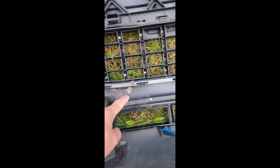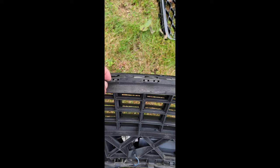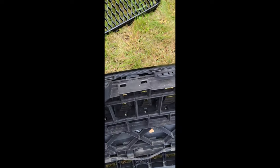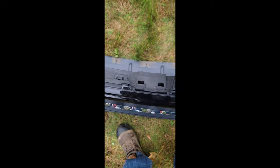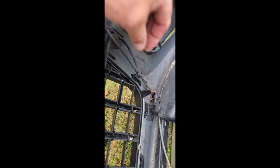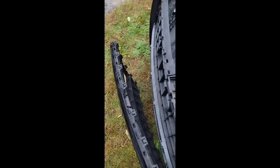To get the grille out you got one, two, three, four, five, six, seven screws. Once those screws are removed there are just little tabs here that you have to push in and pop out. I'm not going to try to do that one-handed but that's basically how you do it. You just pop those out. Once you remove the screws you should pry on these little tabs up and over. When you pop those out it should pop all the rest out. There was a little clip in the way attached to one of the tabs — once I got that off, those popped out easily.